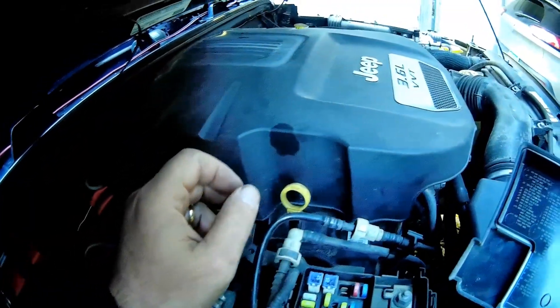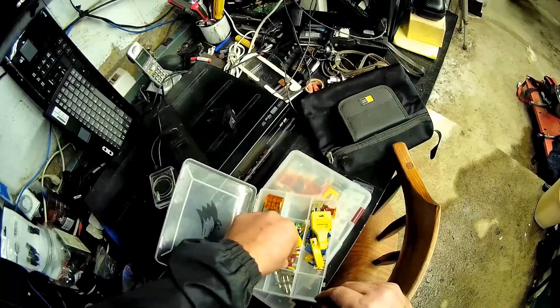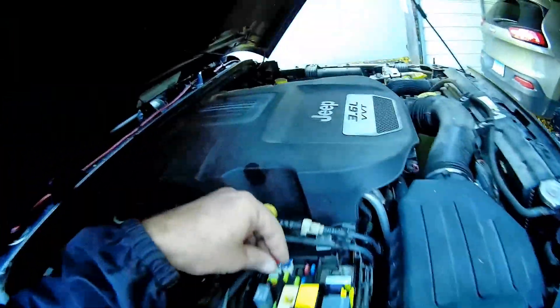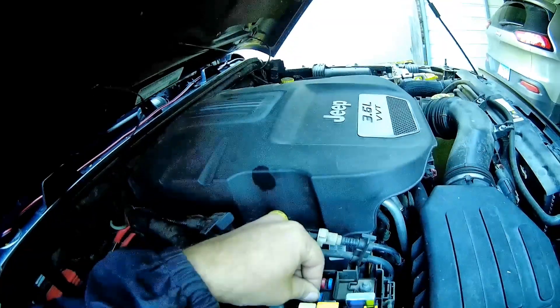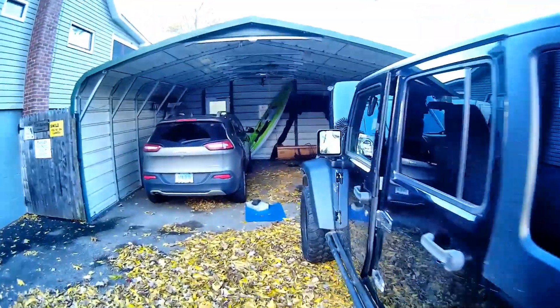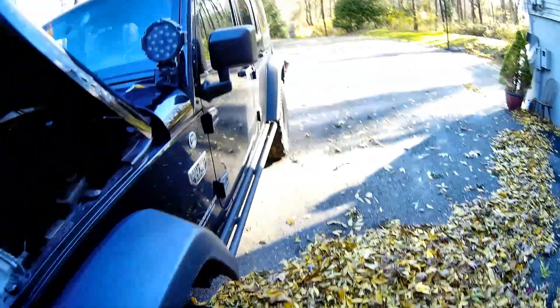How could that not be in there? M4 is a 10 amp — 10 amp is red. Let me check if there are any contacts in there. There is something there, but it's not getting power. I guess I put this away prematurely. I'm going to try to tone that wire all the way back to the fuse box with no power on, of course.